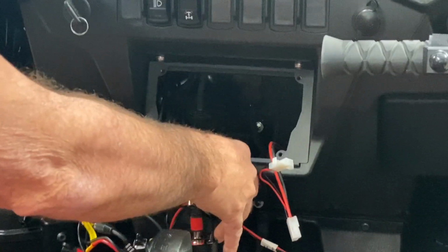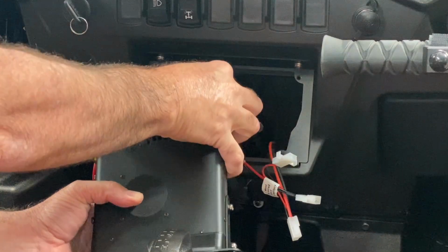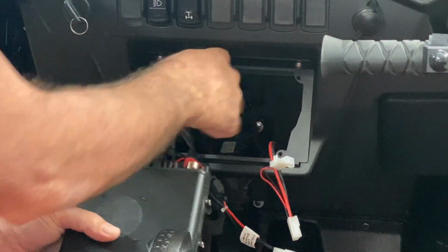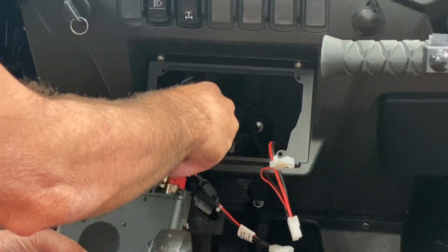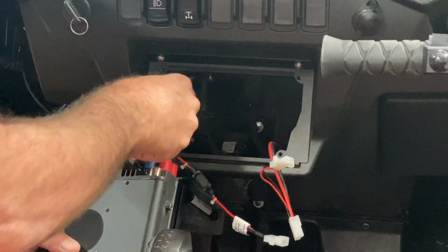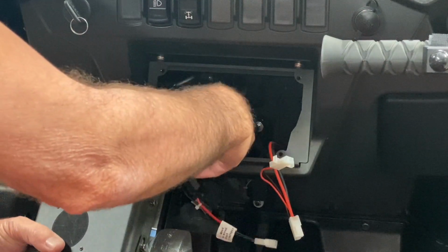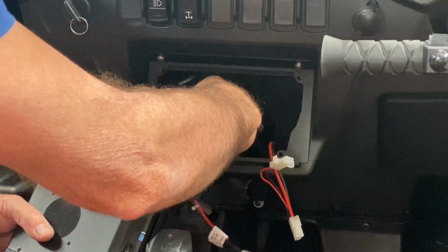The headset cables and PTTs for the front seats are all color coded, so obviously put the red with the red and the blue with the blue. And then the crew ports, those will be the yellow on the back of the intercom. Both of the crew headset cables are black. You can plug them into either one, it doesn't matter which seat it is.